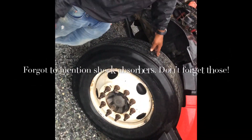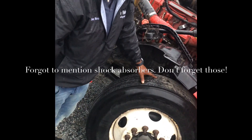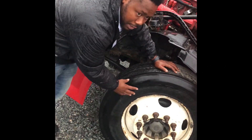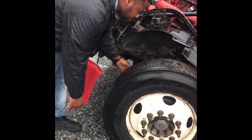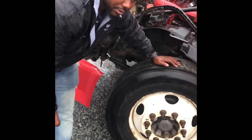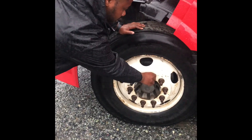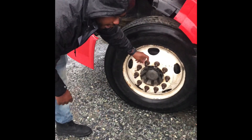Front tires — got to be virgin tires, 4/32 inch tread depth, no less. Make sure the tire is properly inflated to the manufacturer's specifications. Inside and outside rim — no signs of illegal welds, properly mounted and secured. Lug nuts — check them all the way with a commercial lug wrench, properly mounted and secured, no signs of shiny metal or rust trails.